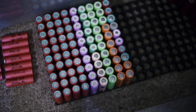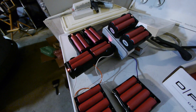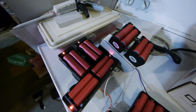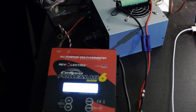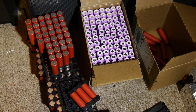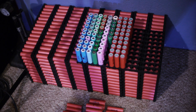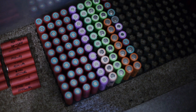After last week's successful tests, this week work on the next 29 modules starts. The problem is that it's a very slow process. Currently I'm charging cells at a rate of about 20 or so a day and discharging them a single cell at a time. This charging at around 1C rate takes about an hour, so I can only do about 5 cells a day, which means that every 150-cell module will take weeks and weeks to assemble.